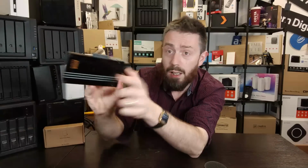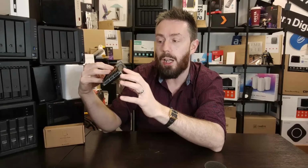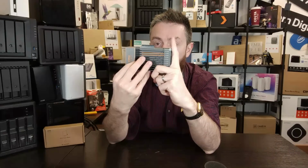And indeed, one of my other stylistic and, dare I say, user-friendly and incredibly innovative upgrades on this compared with the majority we've ever seen of little tiny playground mini server PC-based stuff: this thing's got a PCIe slot slammed on the side. They've even gone ahead and gone for an external protruding PCIe port. Why is that important? Because although it is Gen 2, more on that later on, it means if you go for a larger card, it's not cased in with a hook stopping you using full length x16 cards, which of course will be bottlenecked, but still nonetheless.